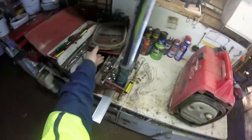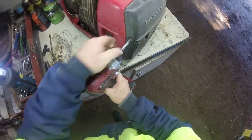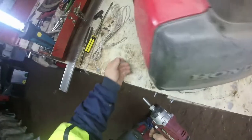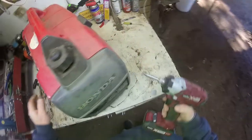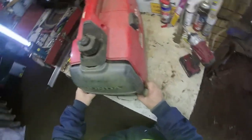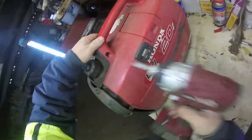That's that off. Just gonna put all the casings over there. Spin it around to the front. One up here. See, told you I've never been that long since I've had it apart. Down here. I just thought I'd bring it along, see how I go. Good having those sort of tools, you're not there forever. Right, that won't come completely off because you've got all your inverter and everything inside that. That'll only go so far. We only want it so far so we can split the case, fuel tank out, that sort of thing. So, spin this around this way, get this one up here.